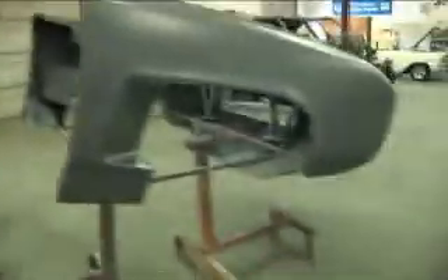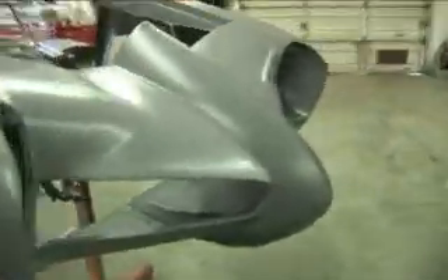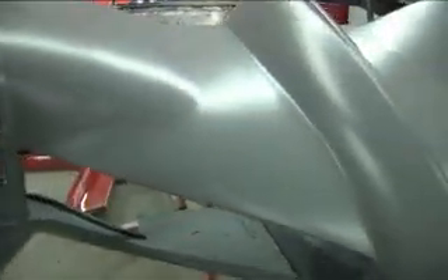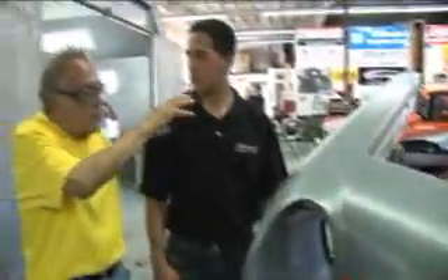The unique part about this car: all of the work we did — the front end and parts — were all welded on the car. Now Brian has made this whole front end in one piece that will fit the complete front end of the car. You rebraced it, and I noticed you sculptured a lot of the inner reverse channels the correct way, without a lot of filler. There's about a sixteenth of an inch or less of skim on the panel to give it its original definition. I just let the metal tell me where to go when I did my skim. It's got all the definition it should have — the peak, the sculpture, the aerodynamic shape — all incorporated into one piece. The hood will fit right on that, giving tremendous strength and durability when displaying and transporting the car.